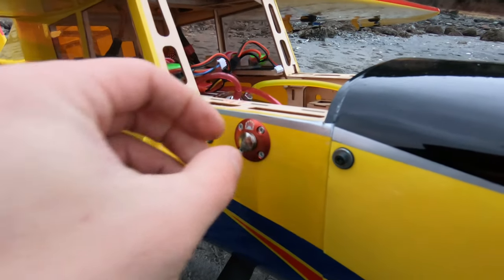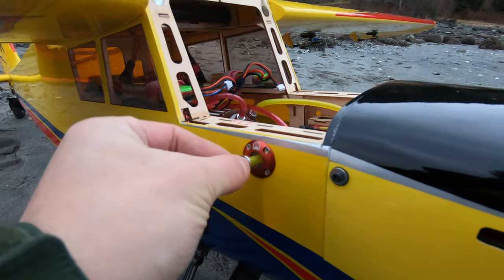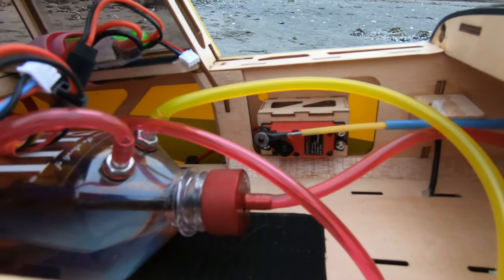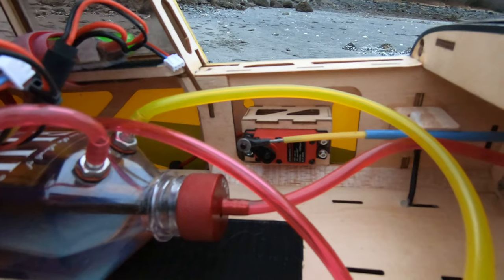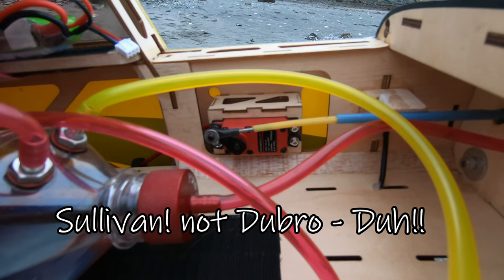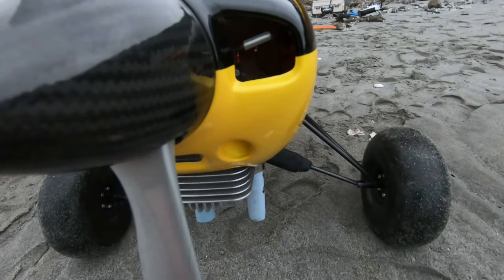That's a Fuel Dot from Northwest RC, also known as a Kooza Fuel Dot — it's magnetic, works pretty good. I like the fitting on there, it's cheap and it fits pretty well. I decided to put my throttle servo right there. I found a little servo holder that I glued in place with some Dubro blue control rod that goes all the way to the throttle — helps with vibration and all that fun stuff.